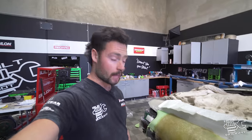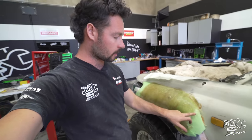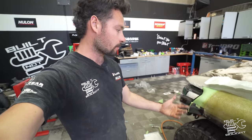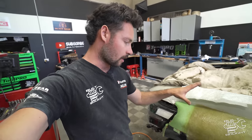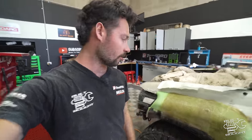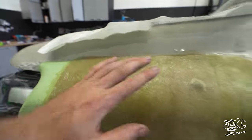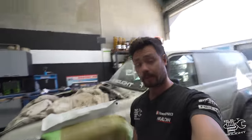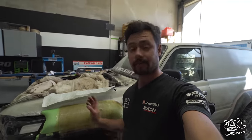It looks like fiberglass — that is a good start. I've done about three layers here and a couple back here so I can blend it into what's happening when I continue on. We'll let that set and see what happens. I should be able to bridge that top gap with some fiberglass filler and then put a coating of bog on there to smooth off the rough texture of the fiberglass. Pretty happy with that — I'll continue shaping the front end now that I know the fiberglass is going to work.